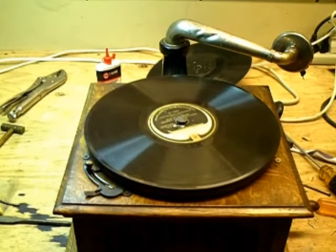Greetings, Benjamin J., the Victrola Guy. I have reassembled the motor on the standard Model B. It was a difficult spring to put back in the spring barrel — this was a really tough motor to rebuild. That spring is really, really stout, and it goes into a very, very small spring barrel. So if you do happen to disassemble your Model B, be prepared for a fight to get the spring back in the spring barrel.